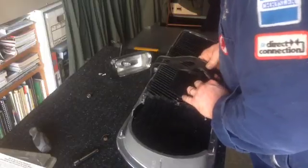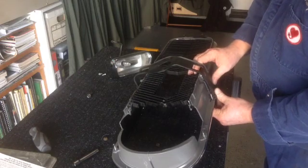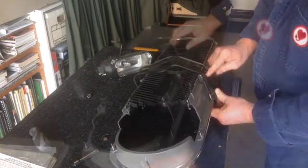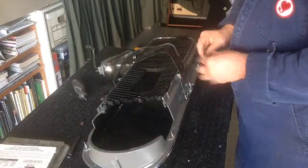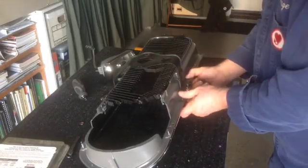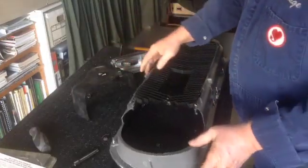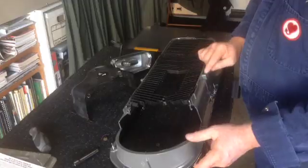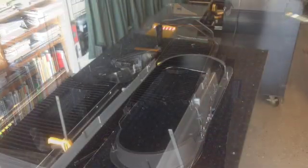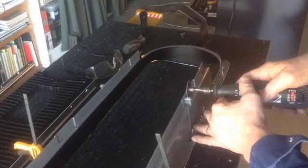You can see the light assembly bracket is squeezing the housing. Thus, the housing studs need to be trimmed to relieve pressure. Once again, I used a Dremel tool with a cutting disc.